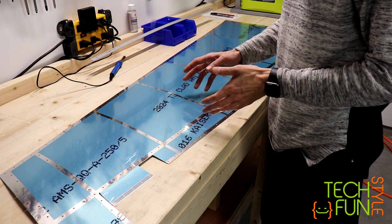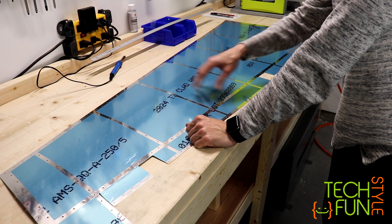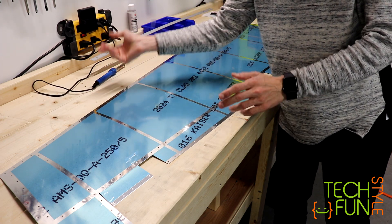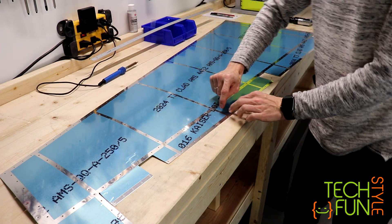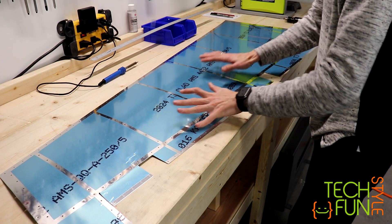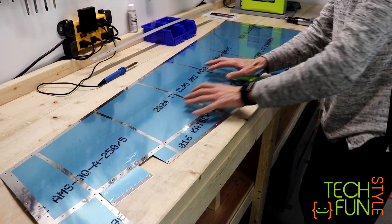The surfaces will be scratched, and the more scratches we have the more difficult it is to make a nice paint job after for the painter or the shop. So I prefer just to make nice cuts. I simply use a regular soldering iron — it's about 60 watts, so not that powerful. And I removed it — look how nice it is, all along the holes. Now I can deburr the holes, now I can dimple the holes, I have full access to the holes, and at the same time the biggest areas of the skin are still protected with the plastic.